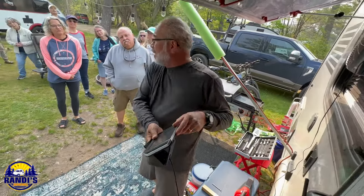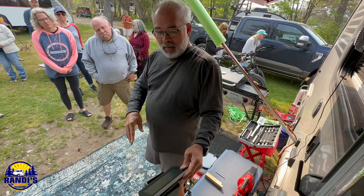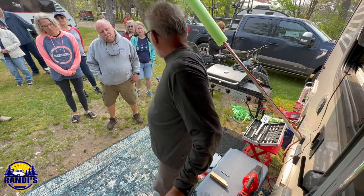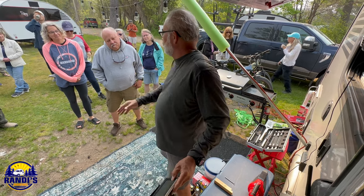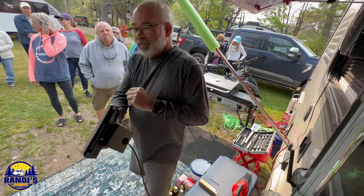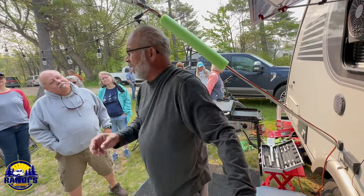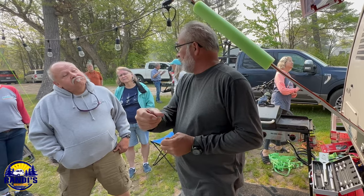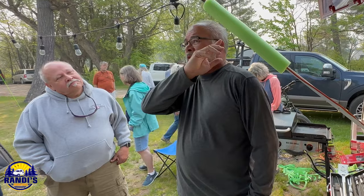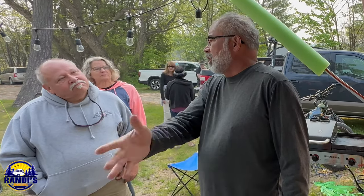We put a camera on the back — you'll see it back there — and I put one on the side as well. This obviously goes in the car so we can see what's going on behind us. We can bring it inside because it runs off 12 volts. When we have all our toys laid out in the middle of the night, I have this camera on and it has a motion detector, so if someone tries to like our bikes more than us, I have awareness that something's happening outside. I went into the control panel and got a hot 12-volt line, then drilled a hole and put a toggle switch in. There are regular toggles but there's a blank spot where you can insert your own toggle. Now when we drive it's not dependent on the lighting system — I have a whole separate source that I can turn on or off as needed. Here's the toggle installed right there.